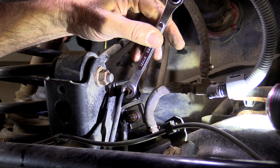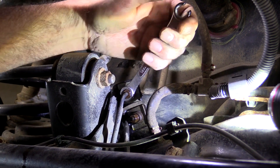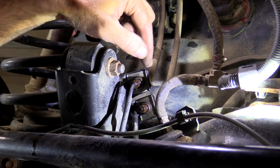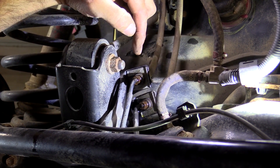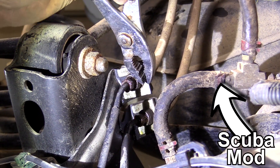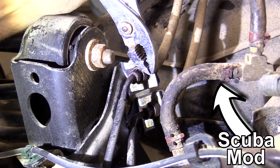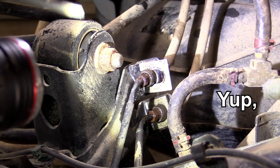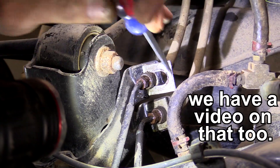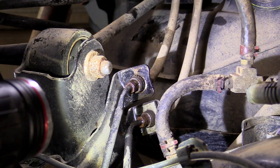Now onto these two down here at the axle. Now we can take out these little clips that hold the line to this bracket. To get the clips out, I'm going to first try a pair of pliers and try to pry them — yep, that's it. You can also put a screwdriver in here too and pry them out with that. And that one's loose.